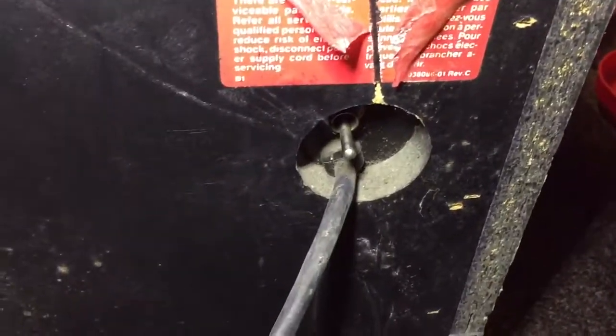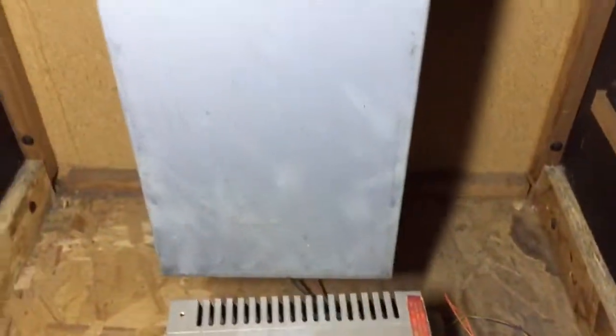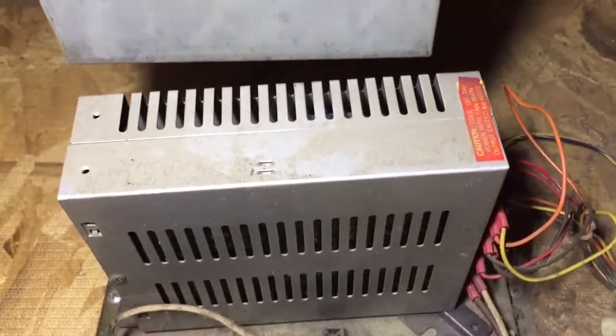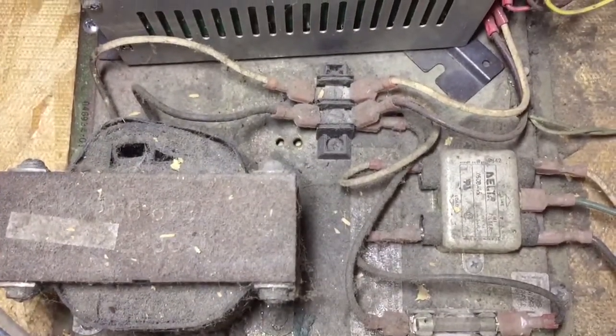For the back - got my flashlight handy. The back door is here and it's got the sheet on the back. Sorry for the crappy camera work. The power on/off switch doesn't work - it's broken; somebody jumped past it. Here's the inside. There's really not a whole lot to see - there's your 4900 monitor up there, the back of the coin door, cash box, and the switcher. That's the original switcher, I haven't changed it. There's your transformer, line filter, fuses, and all that good stuff.